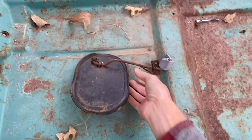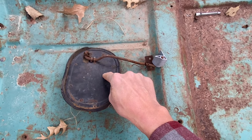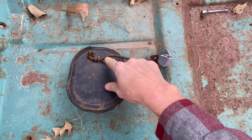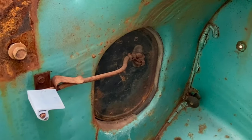If you're going to be buying any of these from Craigslist, Facebook Marketplace, or swap meets, make sure you're buying the right one because they are driver and passenger side specific. This is the passenger side — I can tell because the opening and closing rod comes through the bottom and points up. On the driver side, the rod comes from the top and points down.